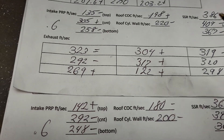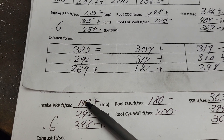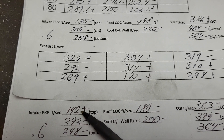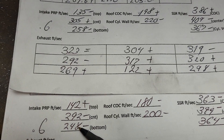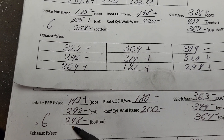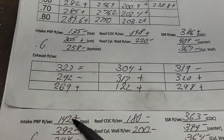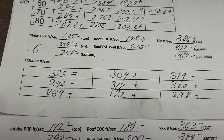Comparing airspeeds: second cut on top, third cut on the bottom. We got a little more even distribution across the pinch — floor, middle, and top. Somebody asked me to do a video on flow balls, so I decided to put the flow ball in the pinch. It actually lost more airflow at the top than at the bottom, which doesn't make sense since the higher air speed is there. I used a good-size flow ball, almost half an inch. So even though it doesn't show a lot of velocity, we do have something going on with that roof.